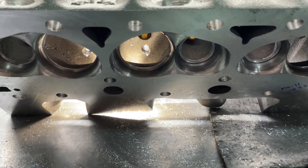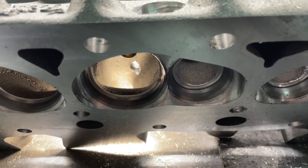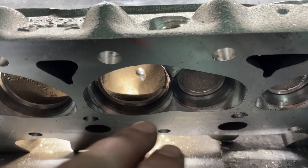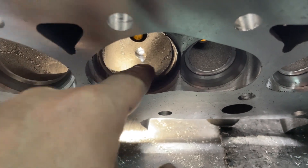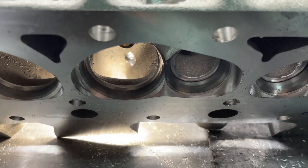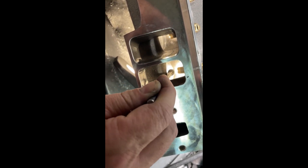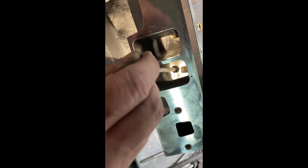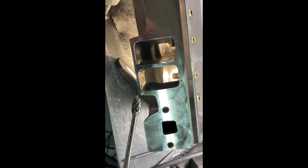Here's a pro tip on why I port in that order. You can see how dark it is in there even with a light shining directly on it — that's because the cast surface doesn't reflect light. If you do it the way I described, all the ported areas will reflect light, and then the only dark part remaining is the short side — giving you a better silhouette of where it is so you can work it more accurately. Then I blend the short side angle back, and the intake porting itself is done.